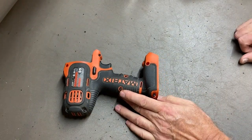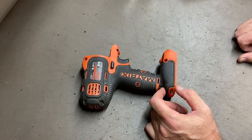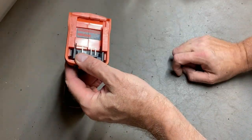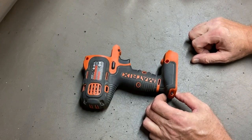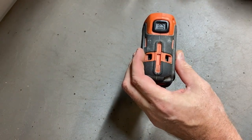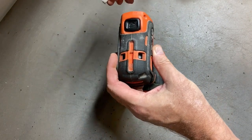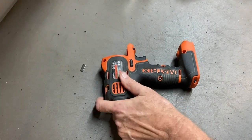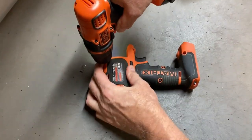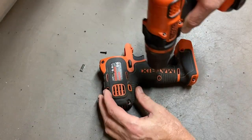There's another good video out there on swapping or changing the motor, but a couple of problems with it. You need to cut this label because it goes across the seam when you separate the housing. The screws are the same, and the other thing is that video doesn't have the magnet up here. There's my magnet — I've already had this apart, so it should go pretty smoothly this time, but that magnet fell out and I didn't know where it went. So if you have one of these that falls out, at least you'll know where it goes. Let's count the screws as we take them out.